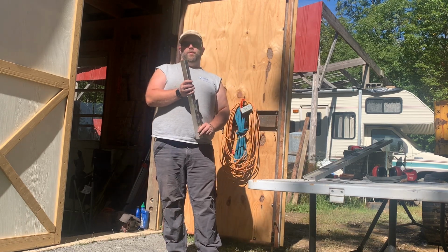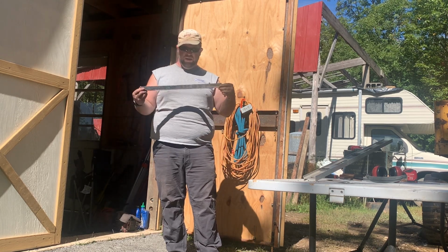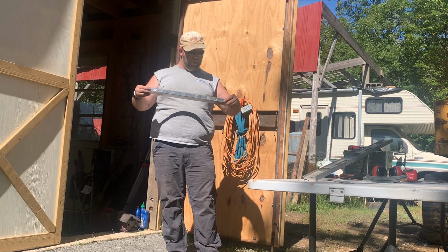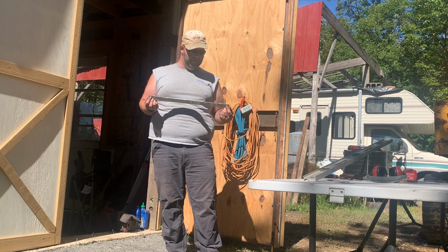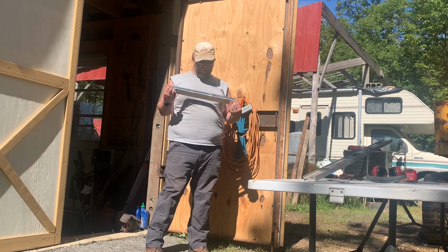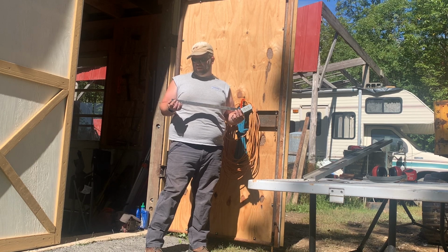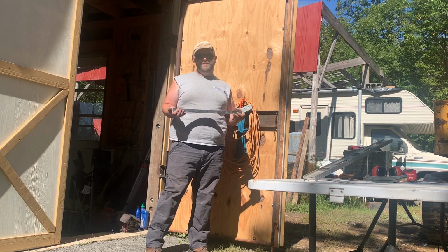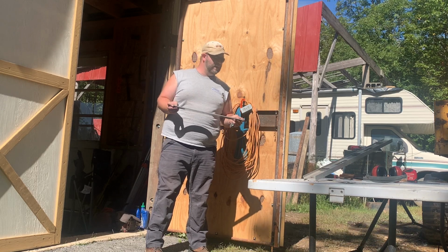And I'll tell you why I was doing this. We're going to be repairing the threshold of the shelter, and I need a piece that looks like this to do it correctly. When this is welded up, I'm going to weld this into a piece of angle. When this is welded up, it'll be, I have it written on here, 1 3/4 by 1 by 22 inches long. So if you go to Lowe's or Home Depot and you want to buy a 4-foot piece of 2-inch aluminum angle by 1/8, or I don't even think you can get 3/32, but it would have to be 1/8 inch, I don't even need to explain it, because I'm sure you all know. It's a friggin' arm and a leg.